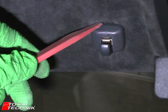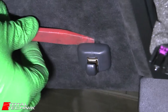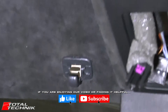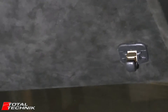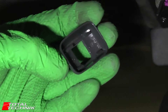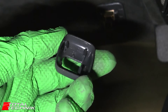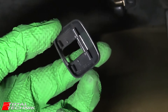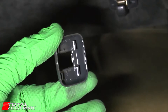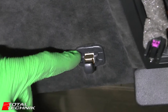So the first thing we're going to do is focus on the cover first — we need to get that cover removed. The cover pops off quite simply if you just slide the trim tool down the front edge. There you go, it's shot off. Looking on the inside, you can see it's got two sets of little barbed plastic tabs that literally just slip on and snap into place. So that part's very easy to get out. The next part, which is what we're facing up here, is not so much fun.